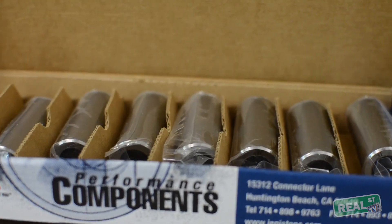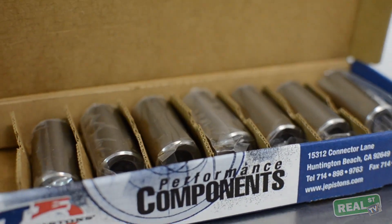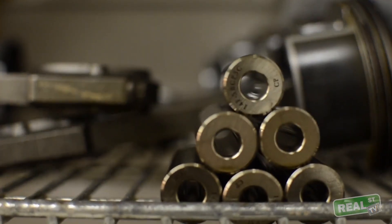In the realm of upgrading your piston pins, it's not a very large expense. When someone buys a four-cylinder set of pistons from Real Street and they want to do an upgraded pin, there's normally just a $100 step charge to get them into an upgraded pin. In terms of what thickness pin you should have, the 200 or 210s are enough for the general population. If you're doing anything really hardcore, you can step into the 250 — they even make a 300.